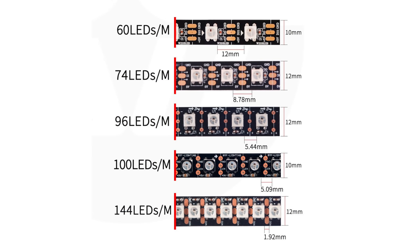If there are going to be ballpark 300 LEDs and each one can consume about 50mA max, that means we need about 15A of current, which at 5V means a maximum of 75W. That's a substantial buck converter, but I happen to have a few 75W examples on hand. For maximum brightness and continuity, we will be using the highest pixel density strips at 144 pixels per meter.